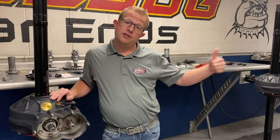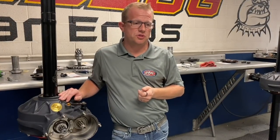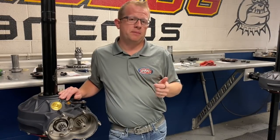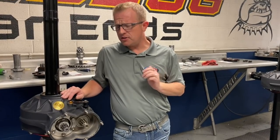If you're on a rough racetrack, you have to count your lap count twice for that night. Instead of saying 40 laps for that night, count 80. Conversely, if you run a really slow little slick track, maybe instead of counting for 40, you might be able to cheat it a little bit and only count for 20 laps that night. So those are the things.